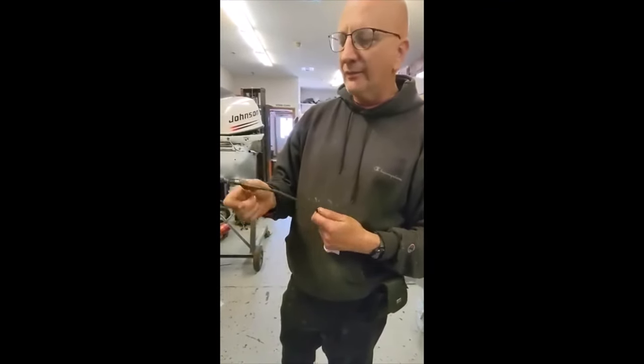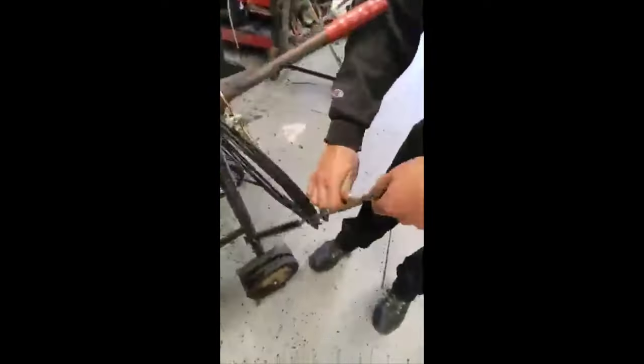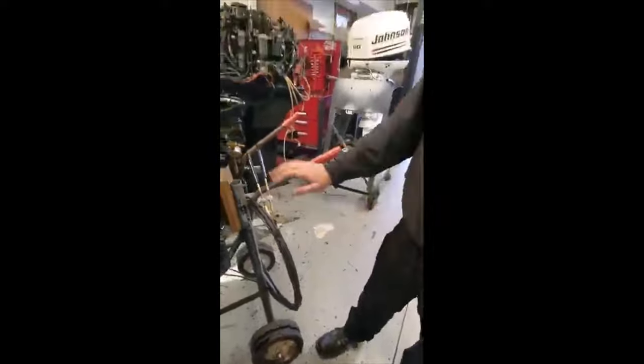Most people just replace it when it's cracked on the outside and you can see rust. Now this one's shot — that's why I cut it off, it's a junk cable. If you notice, this is a brand new one — it doesn't crack. When you bend it, it bends back. It's got some spring steel in there. That's a good cable.